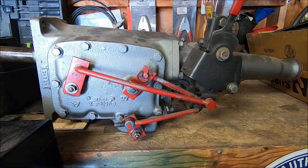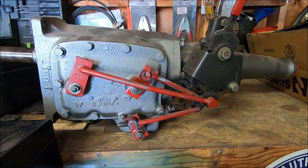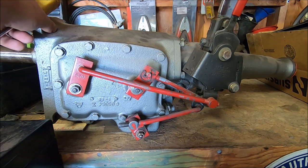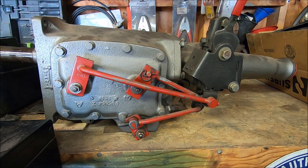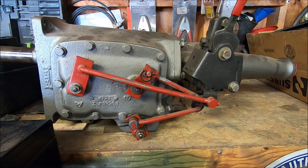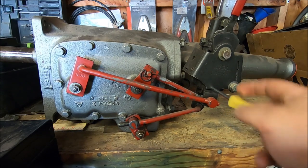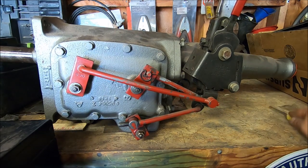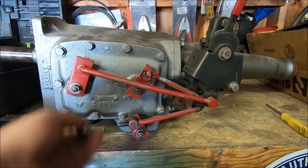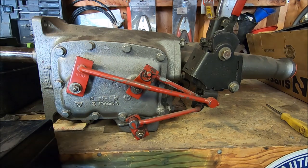As you can see, our screwdriver doesn't go all the way through. But this shifter does work in all the gears - we have 1, 2, 3, and 4, and we also have reverse, but it's kind of hard to move over on a bench. We want to make sure this thing shifts perfectly - it could be over-shifting or under-shifting. So what you're going to need is a half-inch socket, and you need to unbolt all of these rods off of here.